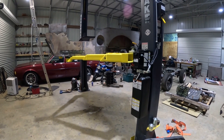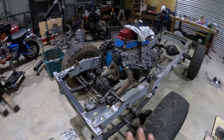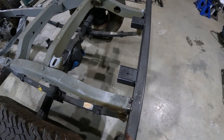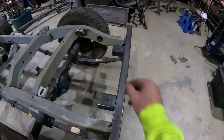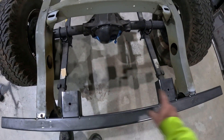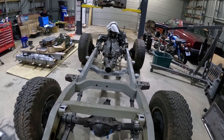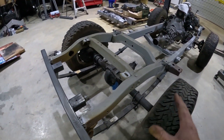It's been a couple days since the last video, and things have been done. I put some tacks on the motor mounts and the steering mount. Back here I cut the rear of the frame off — it had some nasty crossmember stuff — then tacked on some two-by-three tubing across the back as my new bumper, and tacked some two-by-three tubing for the last two body mounts in the bed area. Got everything off the frame and rolled it under the lift — I could lift it but nobody else around here could — so used the lift to pull the body off.